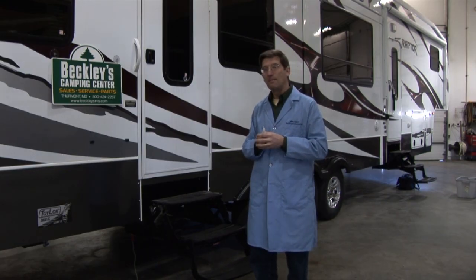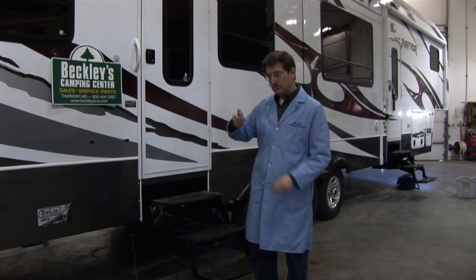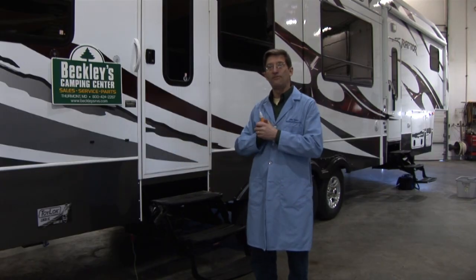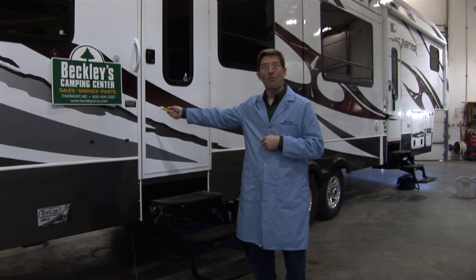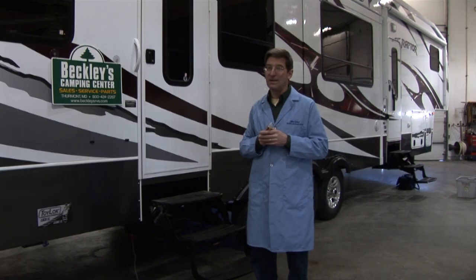A really good thing to do after you've plugged into your campsite shore power is to simply take a volt alert, turn it on, and walk up to your RV to test and confirm there's no voltage. I would use one of these as I'm walking around visiting other people at a campsite and check everybody's RVs. If somebody has a dangerous voltage, immediately notify whoever is acting as the electrician at the campsite. Turn off the power to that RV right then, because that is the condition that can cause electrocution.